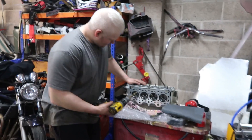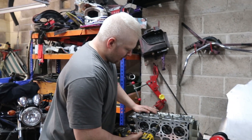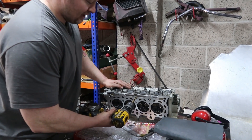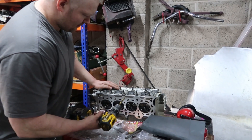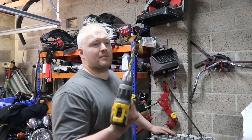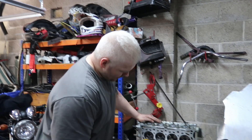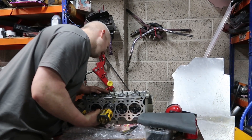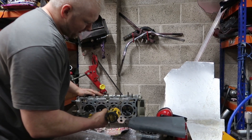High precision machine here. These holes are just very, very slightly too small. So I'm just going in with this just to clean them out — barely anything really. That's all it is, and that means a K20 bolt will go through. This is like 11mm, but if you measure it it's like 10.95 or something like that. Near to it, but the K20 bolts are really nice and tight in there. Happy with that — I just need to do that with every one of these.